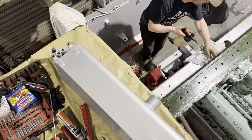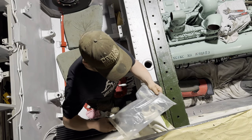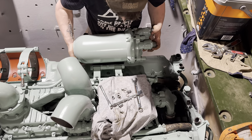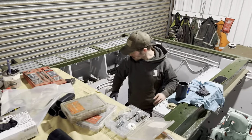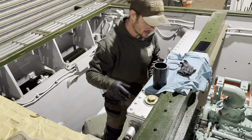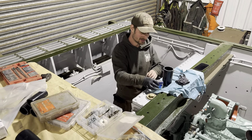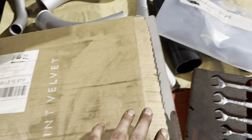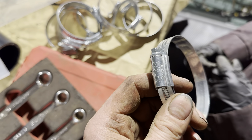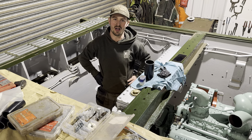The next thing to do is fit the header tank. Ready for filling with water then? Go get the water. All right, so we've got the water parts in. There's one just there — that one's under the gearbox, that's the one. Now we've got to make these fit over them, so trust the Vaseline. That's why I've got a glove on. We've got all the brand new genuine jubilee clips in here. It's not like that rubbish on the T-72 — basically just a piece of tin foil with a corkscrew in the middle. She's starting to take shape.